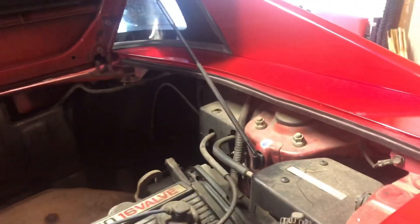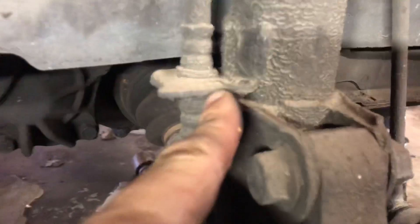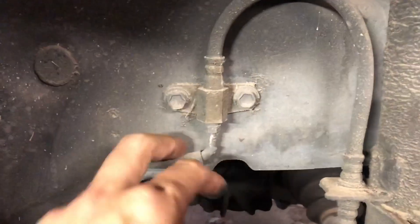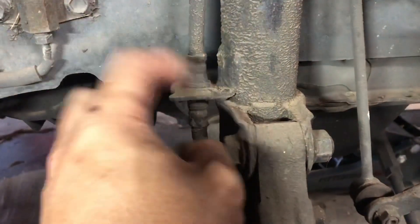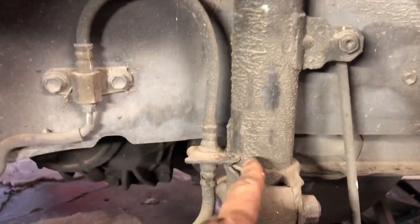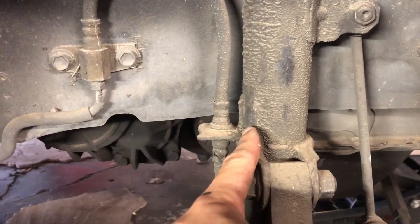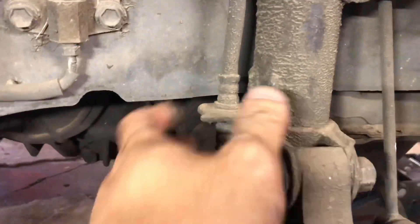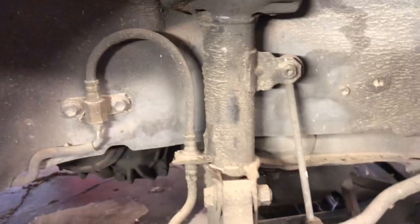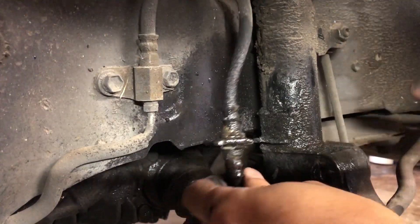We'll just disable that for now and I'm gonna do that side, then take both these struts off. This part is welded on to the brake line, so you literally have to disconnect that and bleed your brakes, or disconnect it down here somehow, just to change your strut out. That's ridiculous. So what I'm gonna do is take a metal cutting blade with a jigsaw and just cut this off — cut right down here, careful not to cut your brake line, and cut it off the strut. The whole brake line is now free from the strut.